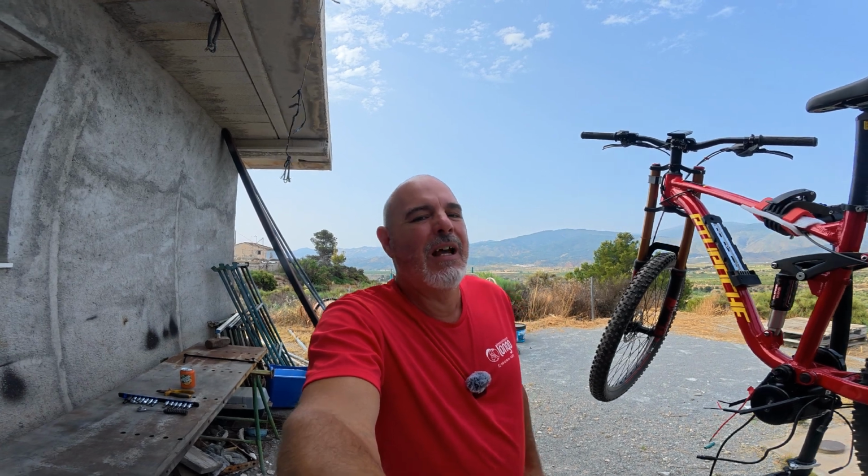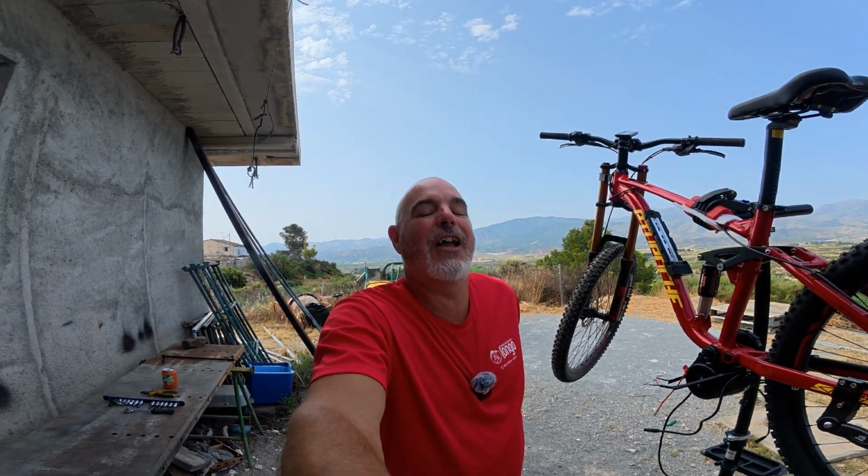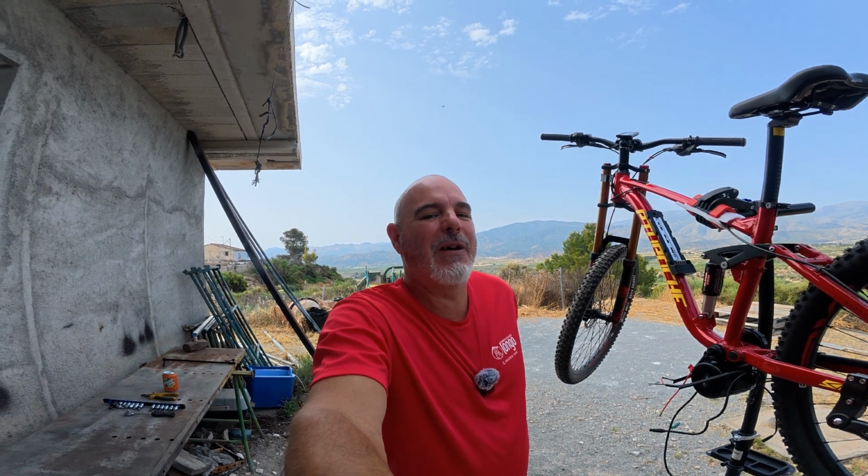Welcome back. It's next day now. I was struggling with the soldering. The new cheapy gas solder was just rubbish. It kept blowing out. I had to resort back to using the electric one, which is only 45 watts. It really needs to be at least 80 for soldering these sorts of wires. So I was really struggling with that. And then I lost the shade, so I thought, yeah, we'll call it a day. But I'm kind of glad I did, because you've probably all been shouting at the screen, you've missed this, and I haven't heard you. But yeah, I've made a bit of a mistake.